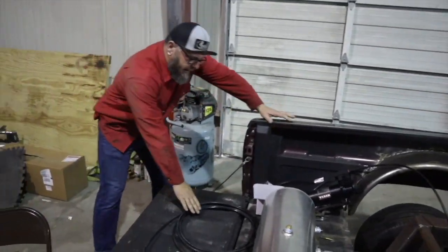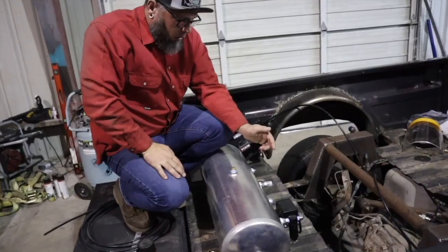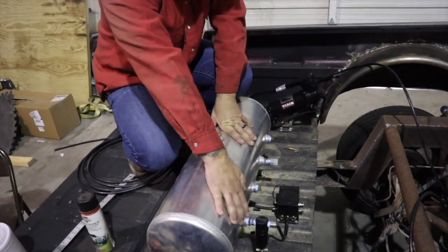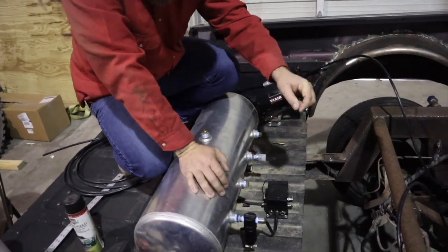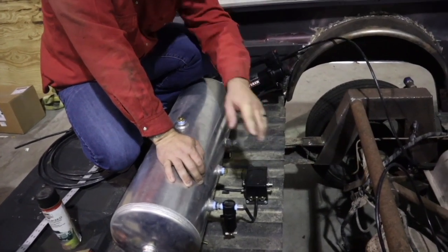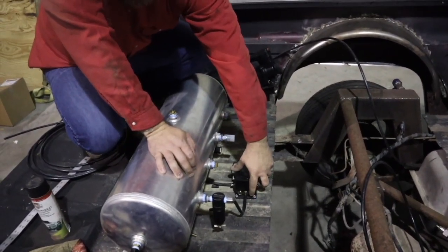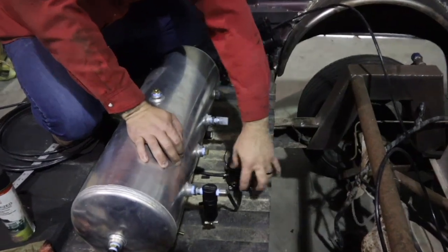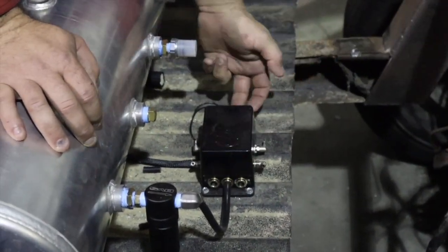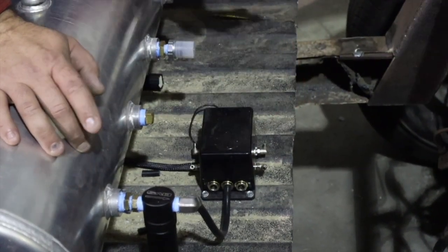So, like I say, two compressors coming in. We got a drain at the bottom. This is your supply line to our Slam Specialties 3/8 valves. This is a four corner. So you have one line going in. You have a fitting here, goes to the front, one that goes to the back. Same thing on the other side. It actually has dual inlets. That way, no matter where you put it, you can get a line going to it. You can run two lines in it.